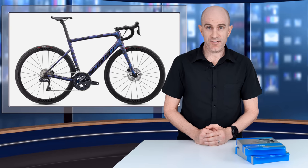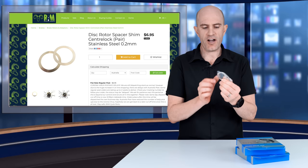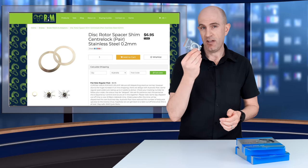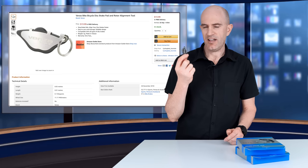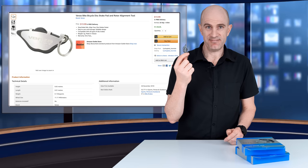But after watching too many videos from this guy here, Tobias, Rides of Japan, I'm a big fan, everybody subscribe, I will link below to Tobias's channel, I picked up some extra tools whilst ordering these rotors. So I have some disc spacers, they're about 0.2 or 0.25 little spacers to put between your disc and your wheel sets if you've got multiple wheel sets so you don't have to keep lining up your brake pads every time. Ordered a set of those, and this little dude here, the disc brake alignment tool or disc pad alignment tool. It's only a few dollars, but this thing is an absolute gem.